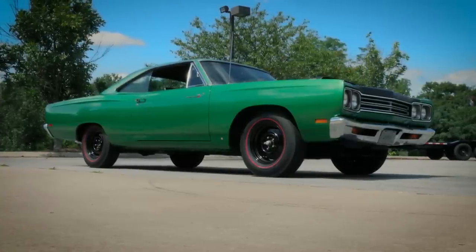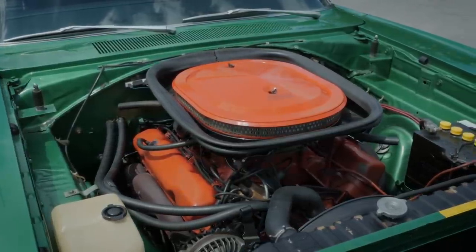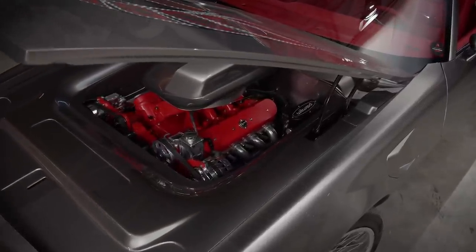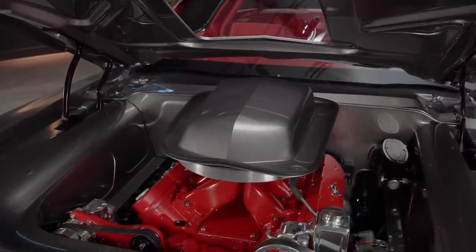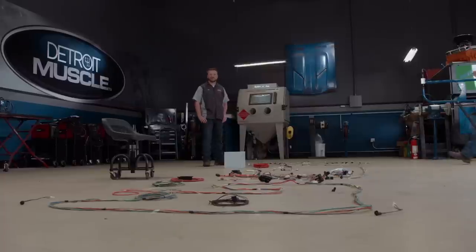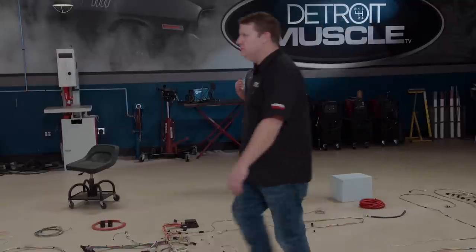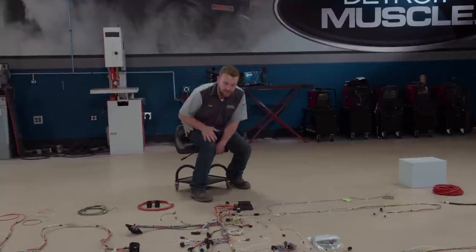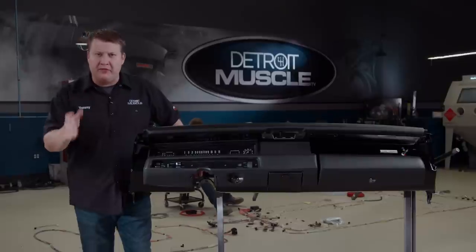The answer has to do with the personality of your four-wheeled treasure. If everything under the hood looked as if it rolled off the assembly line, you probably need something that has more of an OG appearance. But if your ride has a bit more of a hot rod vibe, the tailorable unit would be more of what you're looking for. Often times guys prefer this way so that they can hide those copper core electric hoses for a much cleaner look. Another thing to consider is how many circuits are you gonna need? That all depends on the power options that you plan to be running. What we're gonna be installing on our Plymouth is what you'd call a semi-direct fit harness, meaning it's got a fuse block and connector assembly similar to what would have come on the car originally, but we are still gonna have to cut and terminate a few of those connections. This allows you to move some of your wiring around with the option to connect to some of your factory components.